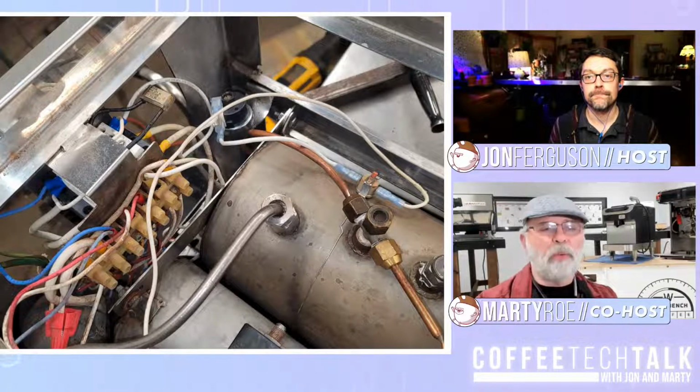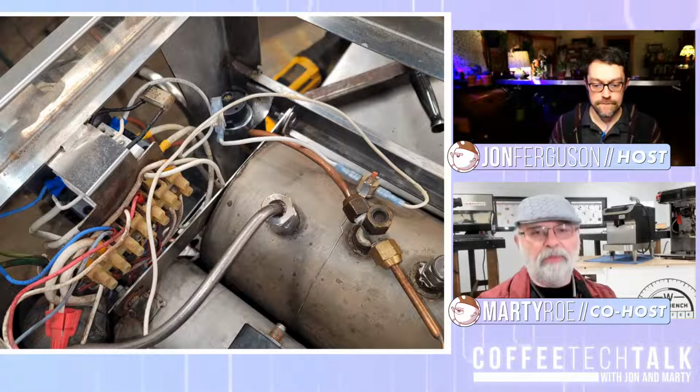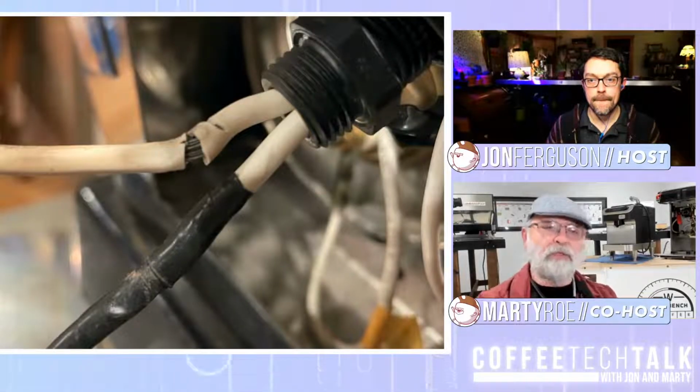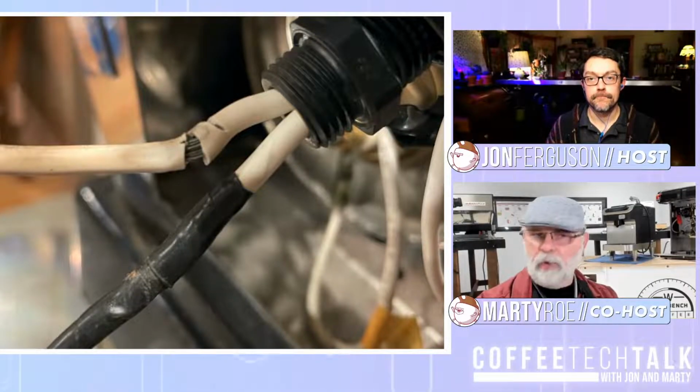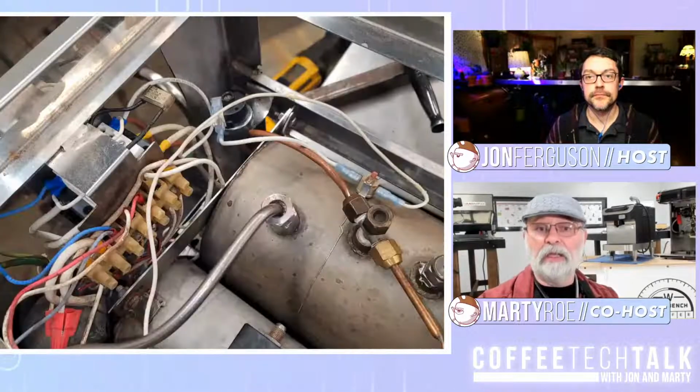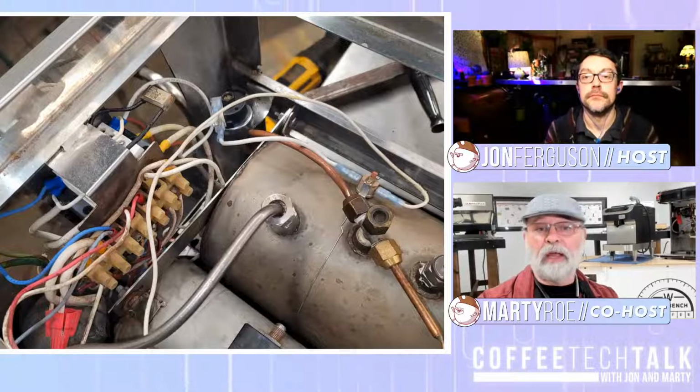If you want to go back, and you probably should, the espresso equipment uses a silicone based wire. It's a soft, easy to bend wire, rated for high temperature. They probably aren't going to have that at a hardware shop, but an electrical supply house would.